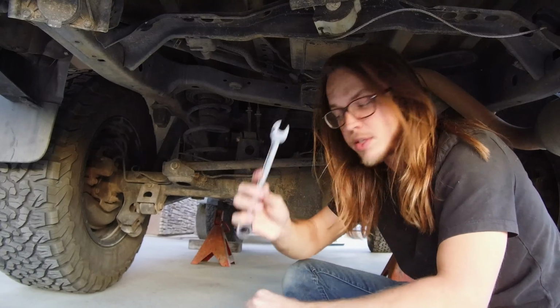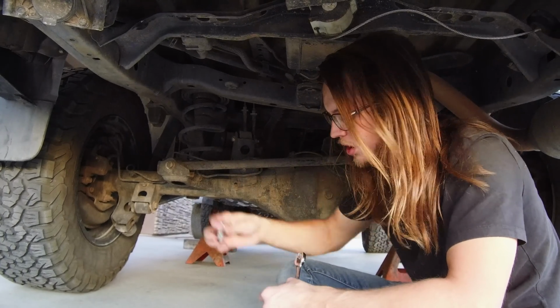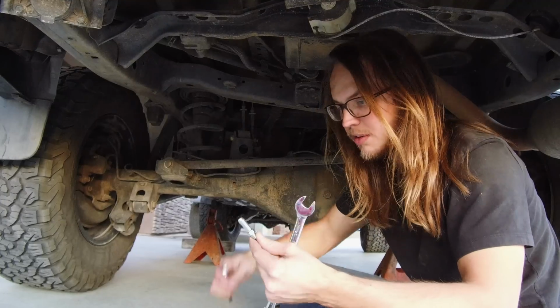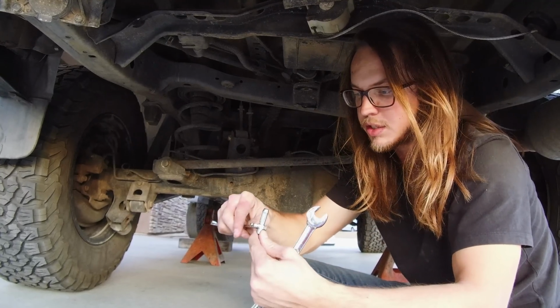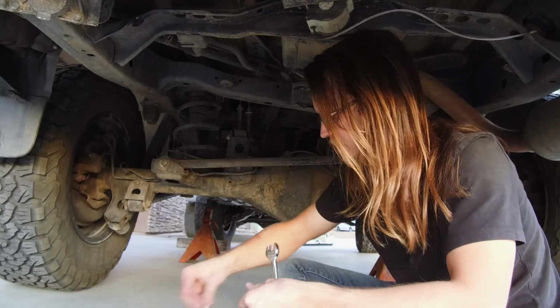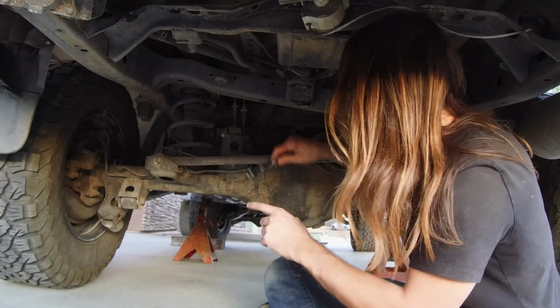So the stock breather is 14 millimeters. I don't know which ones you guys have, but I'll post the link in the description to all of this stuff. The new one I have, it's not the breather, it's just this fitting, is 12 millimeters. So if you have the same stuff I do, you'll need a 14 and a 12 millimeter wrench.